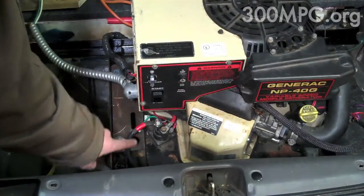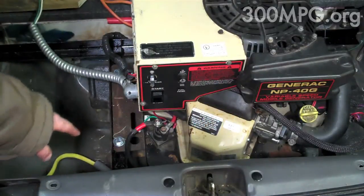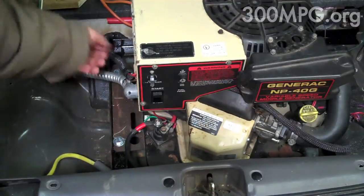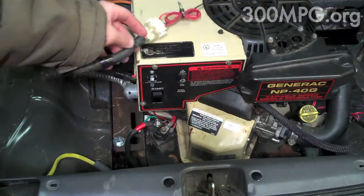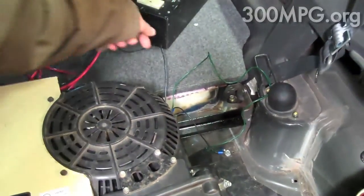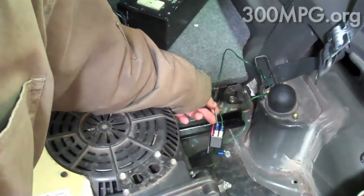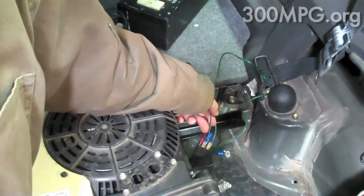Okay, now I have right here a new 12-volt wire that runs under the car to the front of the vehicle to the battery. The ground is through the frame of the generator and the sprocket and the frame of the car. Coming off here, this is the connection that would go to an optional remote control panel for this generator if you had it in an RV, and I found the correct wire to come off of here so that it could be run to a relay. So I've got a relay that when I turn the key to the car, it sends 12 volts to switch the relay, which grounds that pin on the remote and starts the generator.